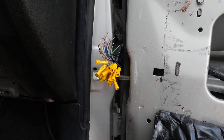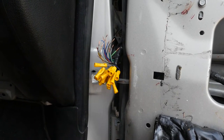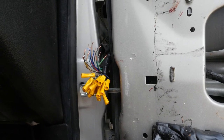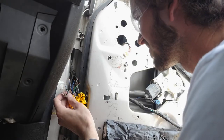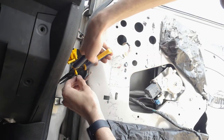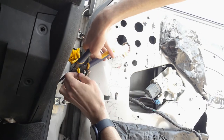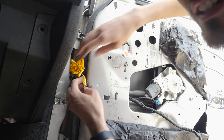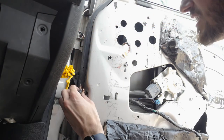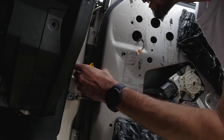Alright, I'm now at a point where I've got all the wires stripped — half of them have the butts on them, half of them are ready to connect. We've got really limited space here so it's going to be difficult. I disconnected the battery so none of these wires are touching each other making things happen. Let's do this. Yellow to yellow. Each connection I make I'll go back and make sure they feel snug. First connection down. So I've got all those wires crimped on there, pulled them to make sure everything's snug.